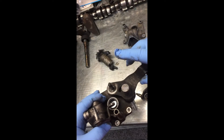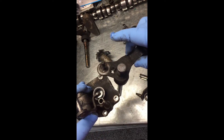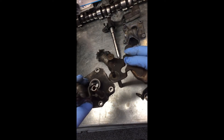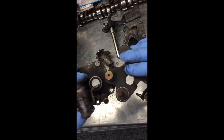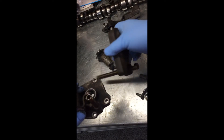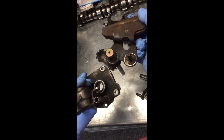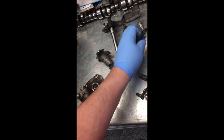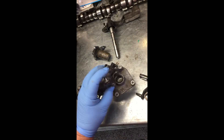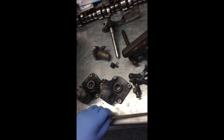The shift selector shaft that comes up and down is moved by that arm, and that arm locates right in the center of the shaft. When you put that into the five-speed housing it locates off-center, which is why we had to change the arm itself. The shifter mechanism on the right with the shaft also locates in a different spot on the transmission, so depending on your vehicle the cables locate differently — that's why I had to use the original selector shaft.